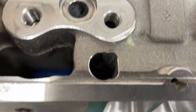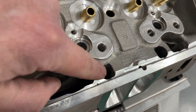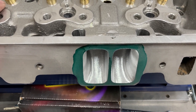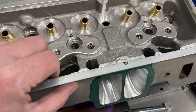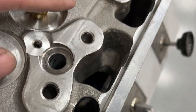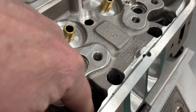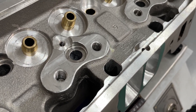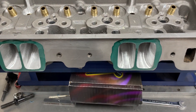The only way to make the pinch bigger is to grind more from this side, but I don't want to break through. AFR makes it a pain if you do break through — unlike some head porters who just epoxy it, the epoxy will eventually crack or come out. The proper way is to weld it and grind it back to the right dimensions, then check with a mock-up block for pushrod clearance. The problem with AFR is they leave a huge aluminum chunk around the pushrod area and you can't get a welding torch in there — except on the 245, which actually mills all that out. That's the only AFR that does.